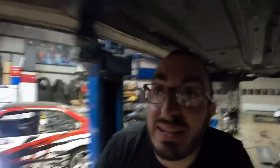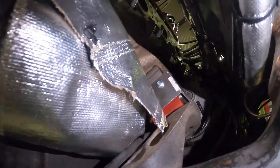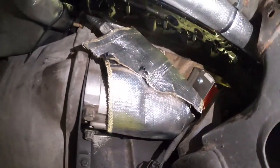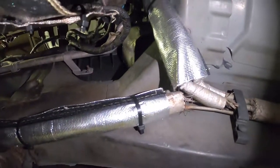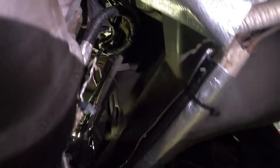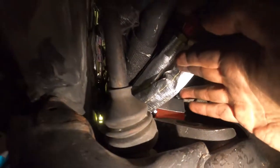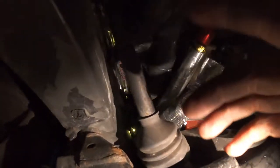A quick update. So, got the motor mounts in. The new Creative Steel two-piece, rebuildable, et cetera. I got a heat shield around my starter. I threw some heat shield around the brake lines. I threw some heat shield around the fuel lines. The brake line one had a heat shield underneath of it, I just kind of stacked it. Fuel line, same deal. Over here, got the Creative Steel motor mount. I got heat shielding on my oil cooler lines. And obviously, like I said, I did the alternator wire relocation.